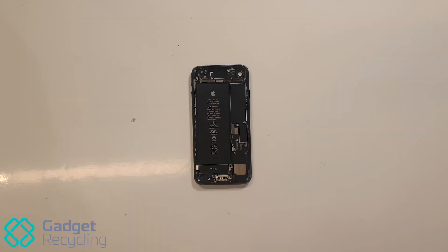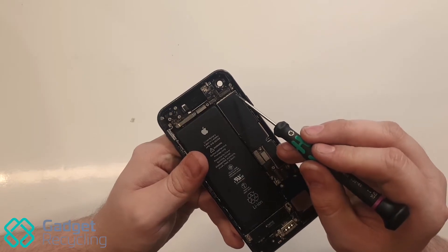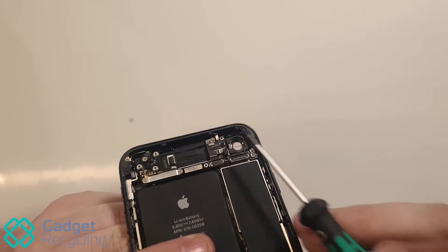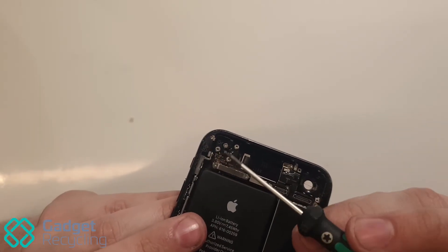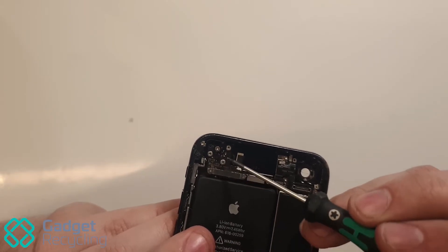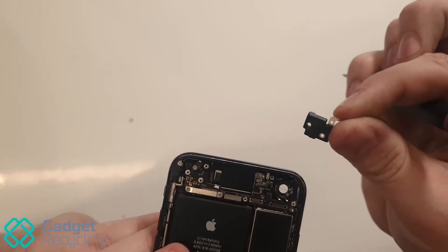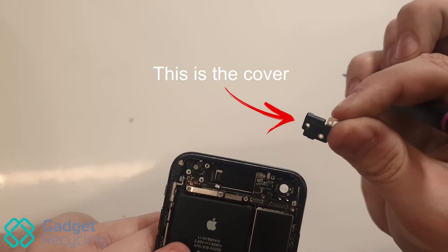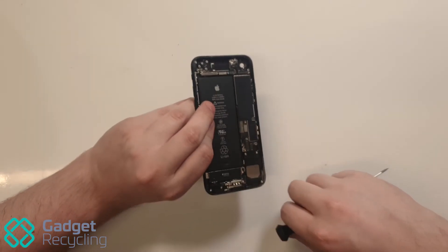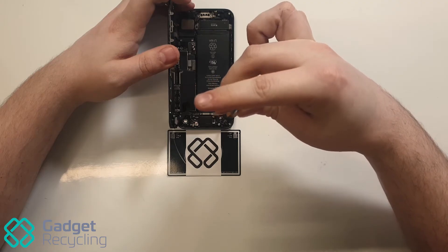The primary suspects on the iPhone 7 are the standoff screws that fasten the NFC flex down onto the board, and the screw connecting the other side of the flex to the chassis. On the other side there are two screws — one for the chassis to another link, and then underneath a hidden cover you have another screw for that link connecting it to the board which presses it against the auxiliary ground. You'll find a lot of the time these screws are just not tightened up enough. We don't recommend doing this powered on, but you can see how a quarter turn here makes or breaks the NFC.